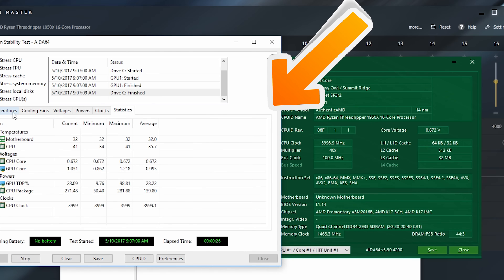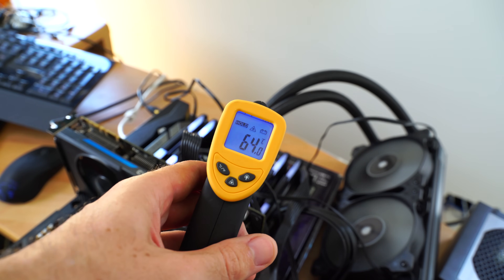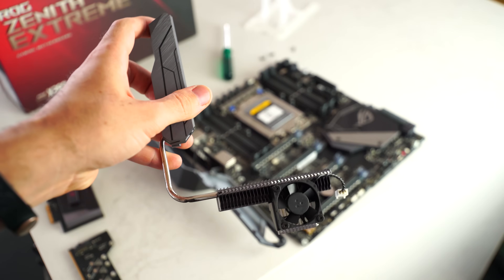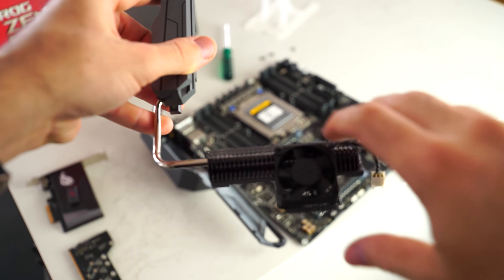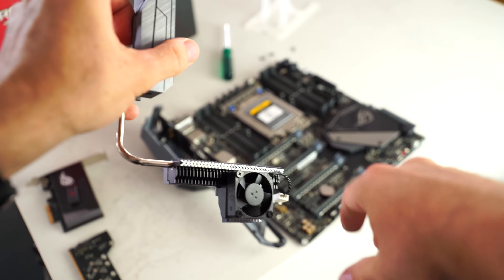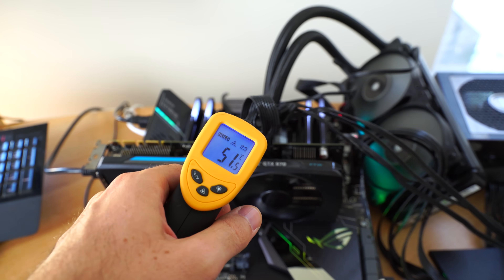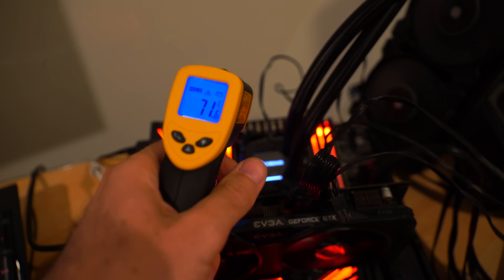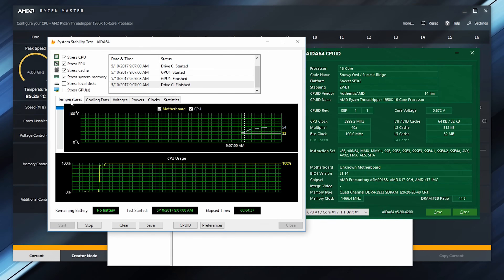All three were providing clean, stable power at 4 GHz on the 1950X. Now, VRM temperatures are equally as important as the actual overclocks themselves — if your VRMs run too hot, you could blow up your motherboard, which has happened to me in the past. I give the nod of approval to the ASUS ROG Zenith Extreme, which has an active cooling solution: a 40mm fan on the left side of the heat sink. This reduced VRM heat sink temperatures down to 52 degrees, versus the ASRock at 64 degrees and the Gaming 7 Aorus at 71 degrees — all after a 10-minute AIDA64 stress test at 4 GHz, 1.34 volts.